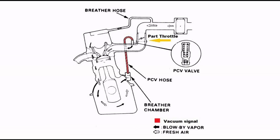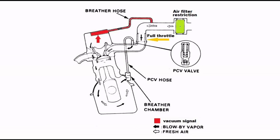for efficiency. And now at full throttle, or anywhere above 80% throttle, the air demand of the engine is extremely high, and the slightest restriction from the air filter means you're creating vacuum within the intake pipe. And that's the moment the valve cover gets to breathe out crankcase pressure through the small holes from the intake pipe towards the valve cover. So the OEM engineers really knew what they were doing.